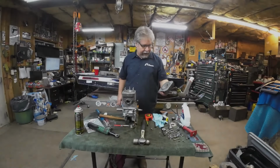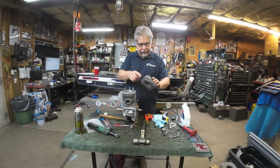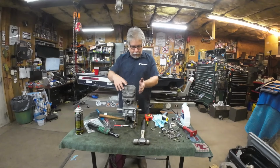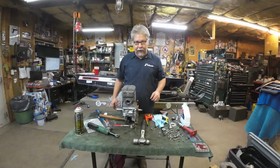All right, cylinder head time. So just a stock uncut head, but it does say exhaust side, and the reason it says that is because there are these bosses for the fan shroud. Exhaust is facing me. Even if it didn't say that, I'd remember those were away from the flywheel side. So I'm going to round up my hardware and torque this down.